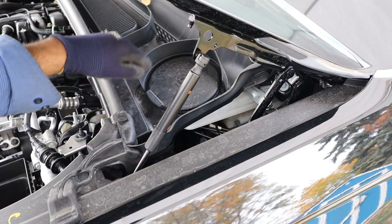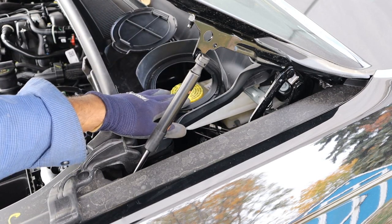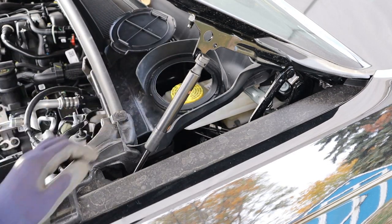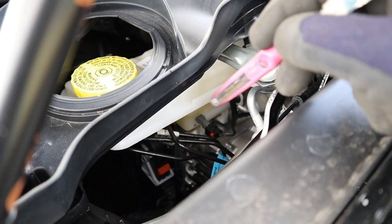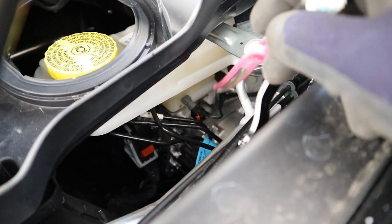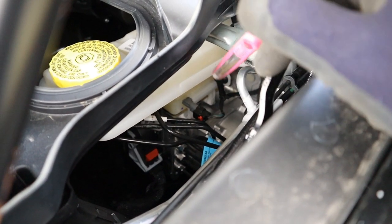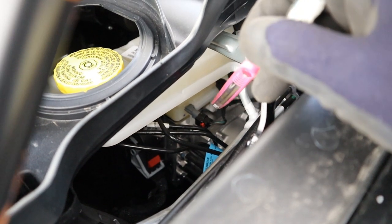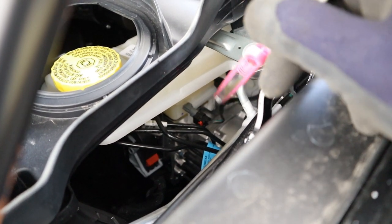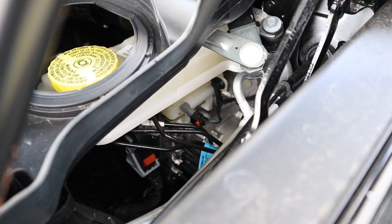Taking a look at the braking system on the Jeep Grand Cherokee, there's an access cover to check your brake fluid but to do any work on the braking system you will have to remove the windshield cowl. Over on the driver's side is the integrated hydraulic control unit which integrates your brake booster and ABS module all together — there's no more traditional vacuum powered brake booster or master cylinder. One thing I don't like about this is that it's all electronic, so it's going to be more difficult to service if you need to bleed it or replace anything.